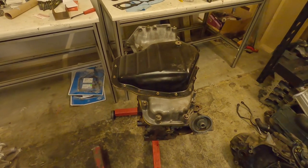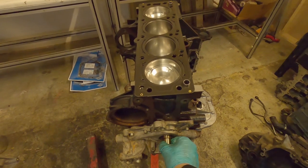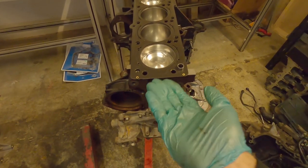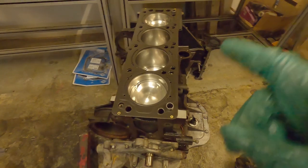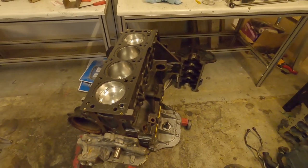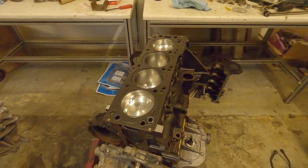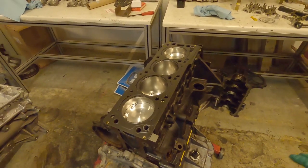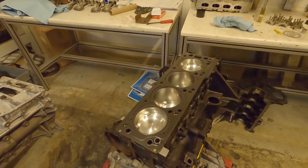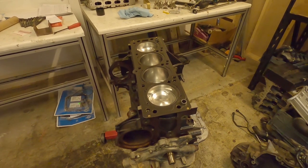It's nearly time to turn the engine over and put the head on. We are setting our pistons in a recessed position — the crank is just ever so slightly behind TDC, giving us about a 30-degree angle to turn to bring the pistons up. This way we can freely rotate our cams and open and close the valves without worrying about piston contact. Make sure you clean everything off again, make sure your head gasket's clean, and make sure you've got your alignment dowels — without those two dowels the head gasket can move out of position, you will not get a good seal, and you'll have head gasket failure. Once ready, lift your cylinder head on and start bolting it down.